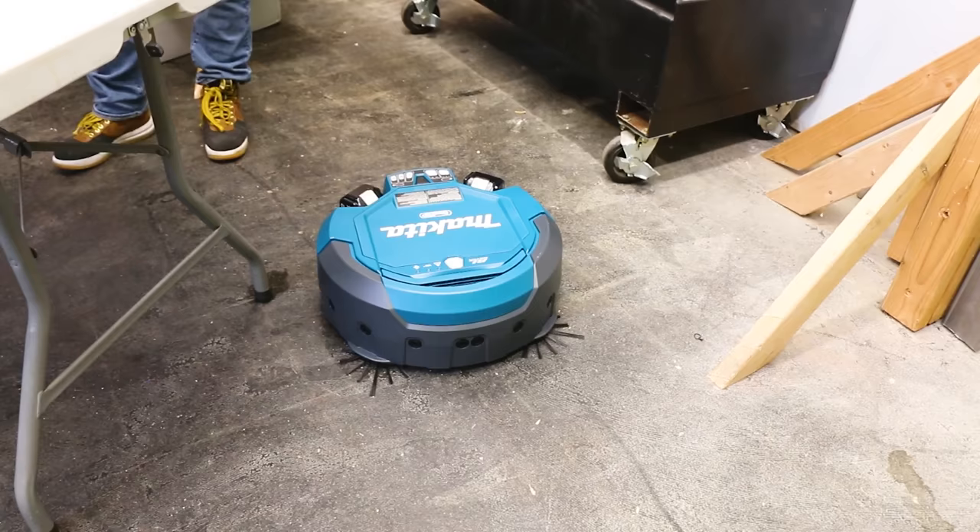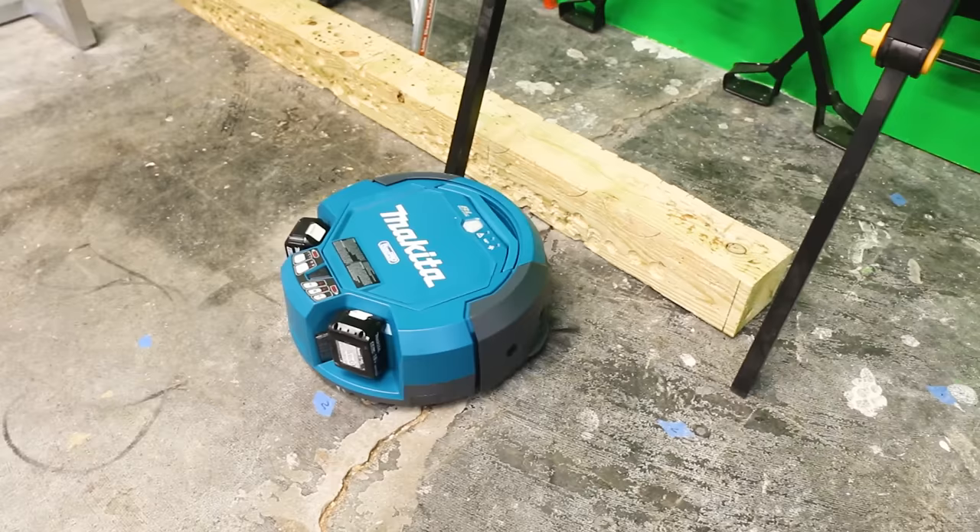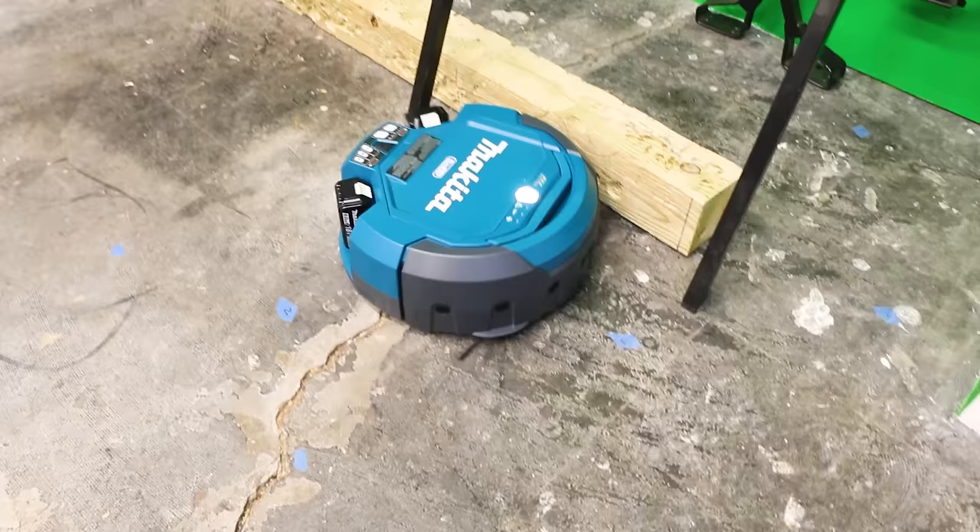When you're making an investment in a tool that is not inexpensive, you want to take care of it. I know it's a vacuum cleaner, but it does require your effort to maintain it. Clean the canister and filter very frequently — I'd try to clean it every time you run it. At least once a week, clean out the hair underneath the side brushes, the beater brush, and under all those components. We're going to let it run for a while and see how it does, running in a zigzag pattern with two fully charged 6.0 batteries.